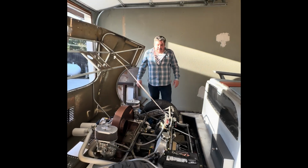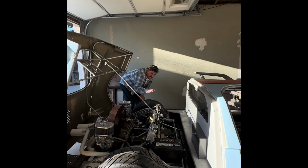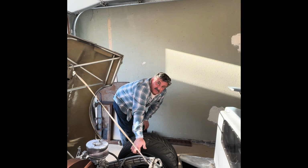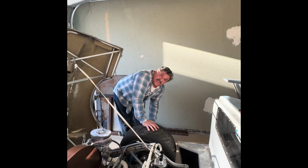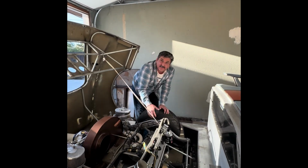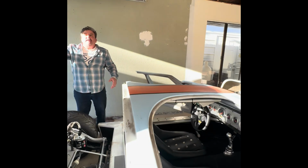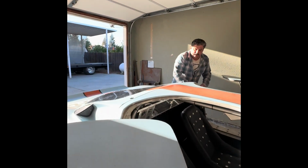What do you call these rims? Well, they're made by American Racing, and I had to buy them 2 at a time because I didn't know what would fit. So now they make disc brakes with Chevy lug pattern. So they're Ford GT40 looking wheels, but they go with the Chevy pattern to go on the disc brakes that they make for these things now. So they didn't make them before. They make them for Porsche, Chevy, and a 5 lug. That's it. So this goes like that.